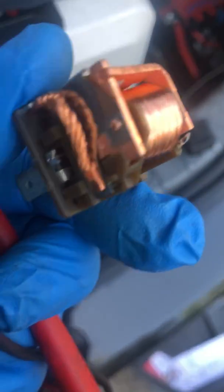I'm going to take this thing apart real quick before we're done testing, and you're also going to want to test the coil inside of it. This is what the inside of the relay looks like. This right here is a little tiny contact that opens and closes, and you want to feel for any contact on the inside.